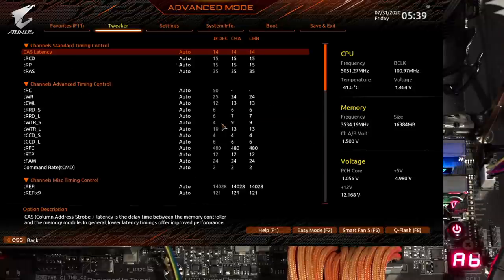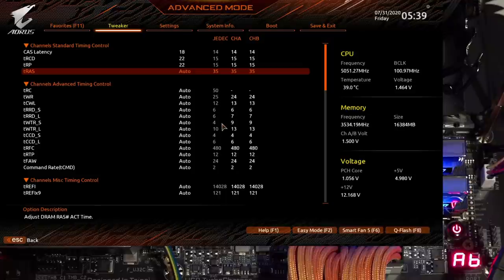41.8 nanoseconds — I think I can match that at way higher frequencies, so that's not really a concern. I also want to get an idea of the read bandwidth: we're just getting 53 gigs per second. I want to hit like 65–67 gigs per second; we should be able to do that. So let's get into it. First up the timings — we're going to start with 18-22-22-42-40.